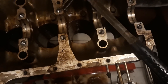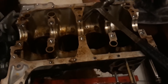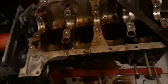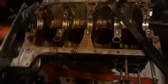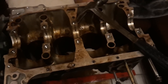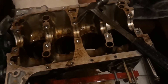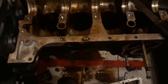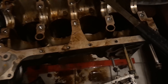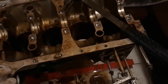I'm super excited about this — the fact that I don't have to worry about finding a crank and the rods are healthy. What I plan on doing is — I've been watching a set of Super Tech pistons, 12.5:1 compression for the K24. They're like $400 and change. If I wasn't already committed to travel obligations I'd buy them now, but I can't spend $400 on pistons right at the moment. Still, the reason this is such a hype moment is because of what this build is going to be.